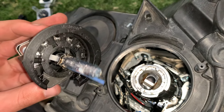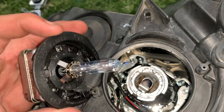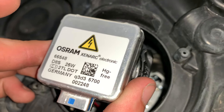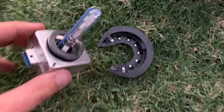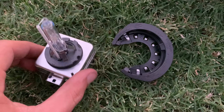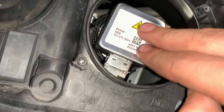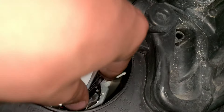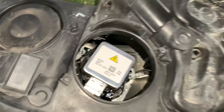To change the bulb, pop off the rubber cover, then pop off that plug. I'll show you how to get off the little plastic black tab that holds the bulb in. You can see there's a tab on each side — reach your fingers in and twist that black piece counterclockwise. Not the light, the black piece. If you have bigger fingers you might need a screwdriver, but my fingers fit. Twist counterclockwise and it comes loose, then just pull it out.